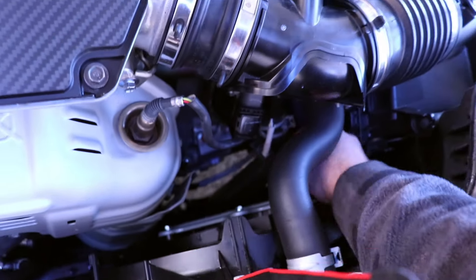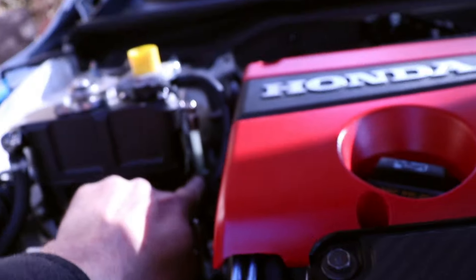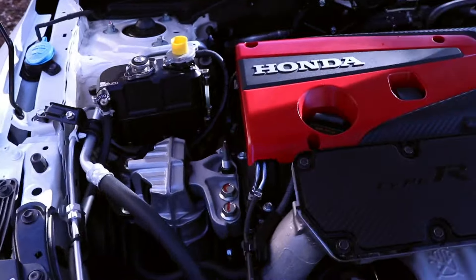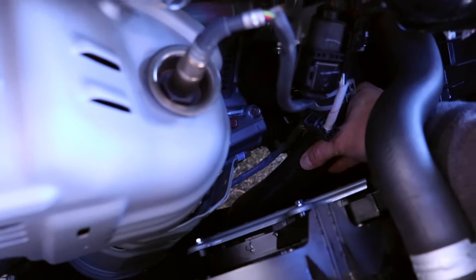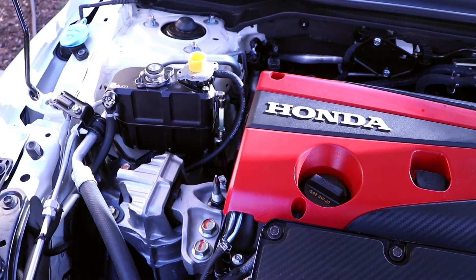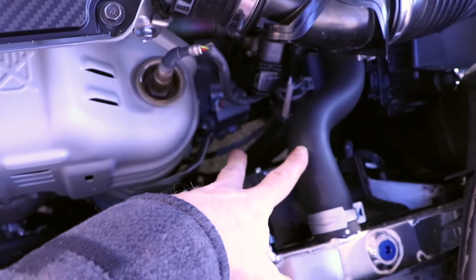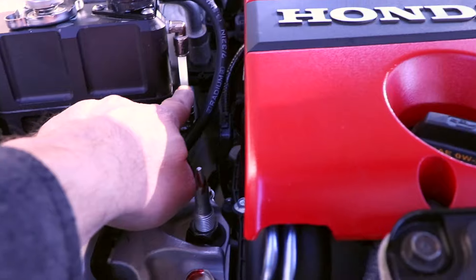The level has pulled down considerably — it's now down here at the bottom — so I'm going to top that off just a bit. That's indicating to me that the thermostat may not be fully open but it's partially open, so any air inside the motor is coming out. I'm going to race the engine a little bit more with the heater off to get it even warmer. The fan just came on, I've got good heat in both hoses — they're now matching — so I'll fill it up to about the halfway mark and it's time to take the car for a test drive.